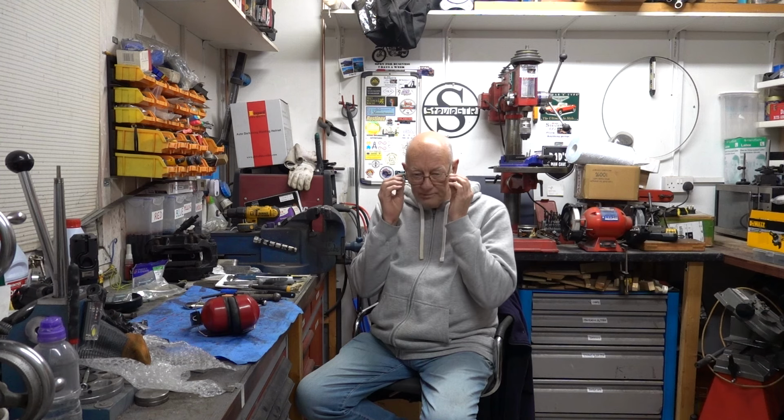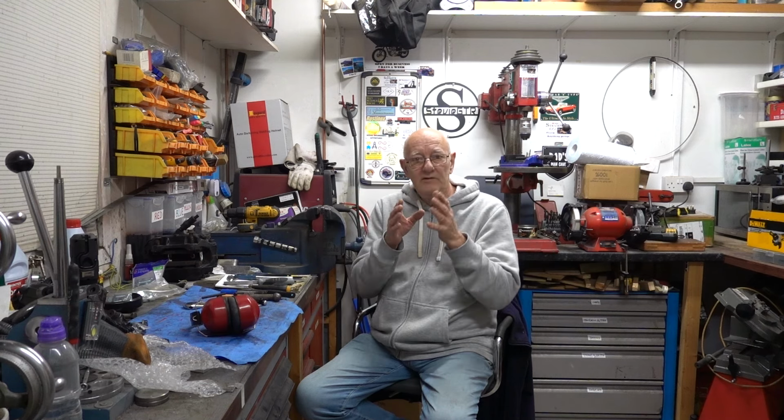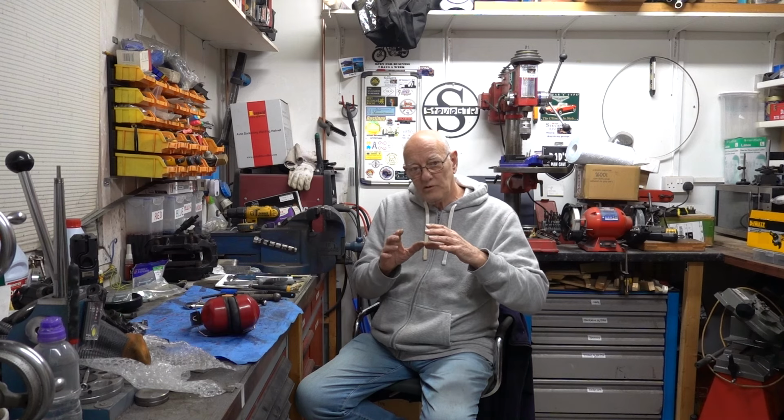Well, that went slowly. It was a lot more difficult than I thought. Problem getting everything compact up to the wheel arch so that the wheel will go on, which I still don't know, by the way. But I've ordered some 2mm shim wheel spacers to go behind the disc. I've put the little washers behind and it works. And in the video I did say I was going to see if there's any way I could move the caliper further back.